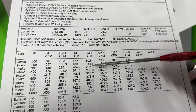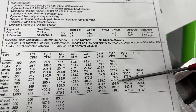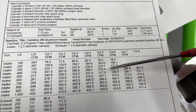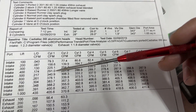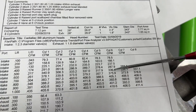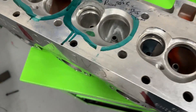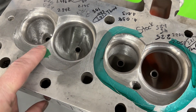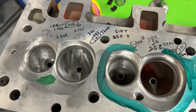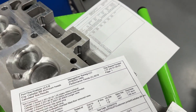This was the experimenting. The flow numbers keep climbing up. At one point it goes 418 and went 405 at .700, which is really good. But it's 287. So the highest number ever came from the 2.300 at .400, and then it kind of stays about that, but these numbers get a little better. I even filled in clay where the spark plug is, which helps out a little bit on the flow instead of having the spark plug sticking in the way. So there were a lot of things tried. It's a really good head.